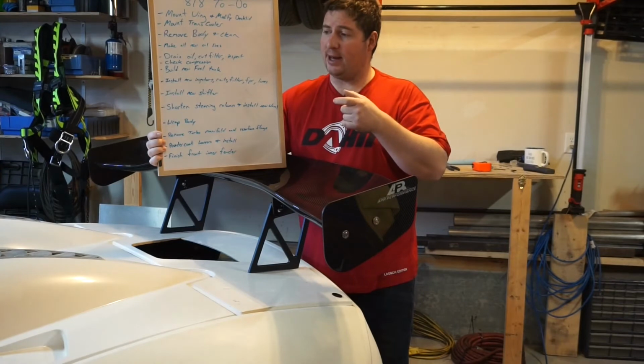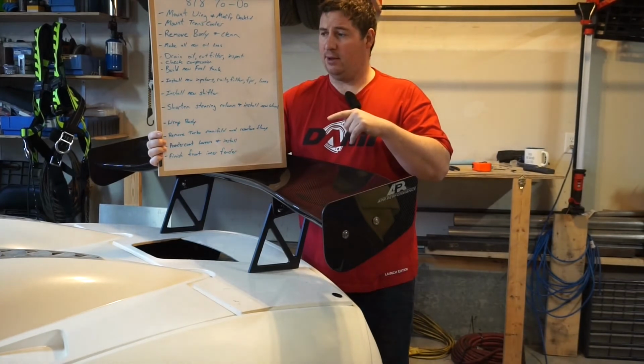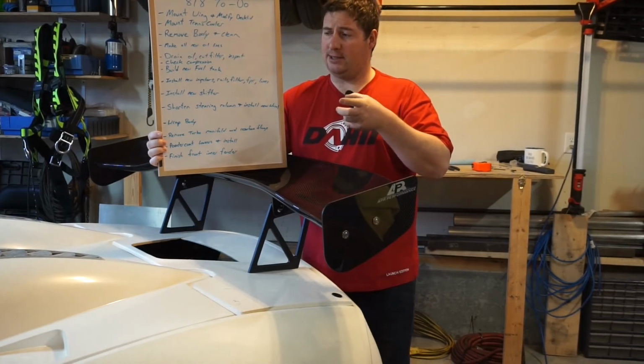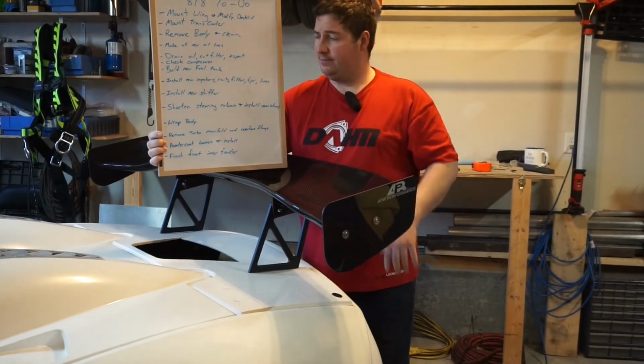Steering column, I hate that gap, and I'm just not fussy about my steering wheel, and I want a bigger steering wheel. That's a 300 mil. My RX-8 is a 350 mil, so I'm going to swap out to a 350 deep dish, and then collapse that steering column to get rid of that little gap between the plastic in the dash.